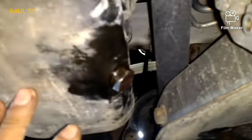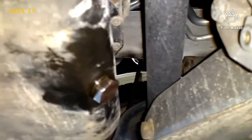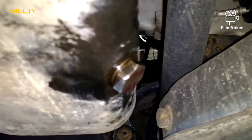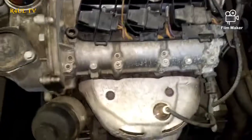You can see I've put the sump plug back on. Nine times out of ten, what I would recommend is you change the oil sump plug — they're only about two or three quid. Every time you do the oil change, change the sump plug as well. This time around, because this is a steel sump, I didn't really have to. On the aluminium ones I recommend you change the sump plug. On the steel ones they hardly mess up, so you can just use the original sump plug. Guys, we've drained the oil — everything's done underneath.